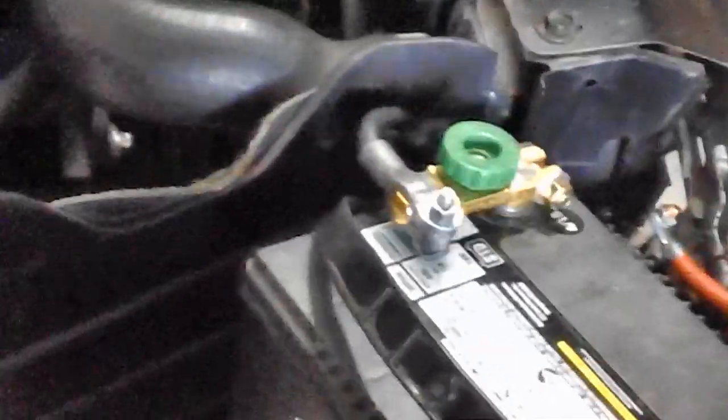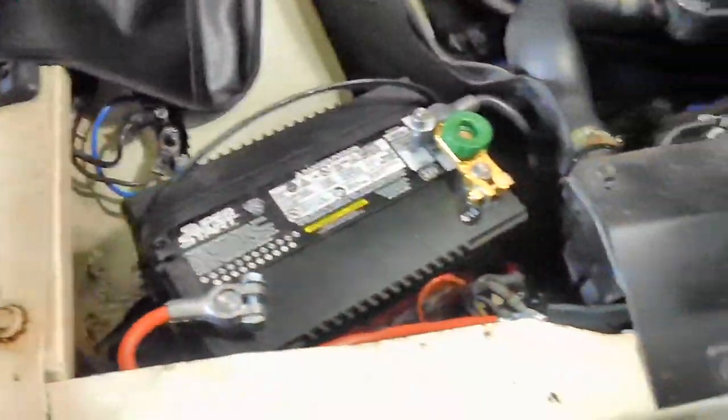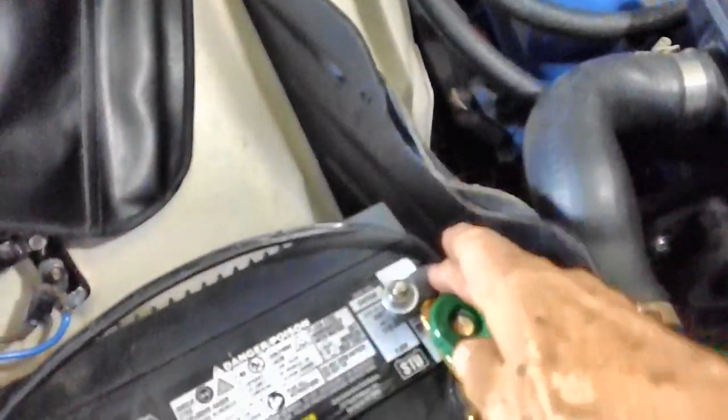So you're back in business on your cable. Now, first of all, why do I need one of these? And how does it work? Well, I do need one of them because there's a lot of wires dangling underneath this car. The wire for this little light indicator alone is underneath there, just hanging. I think one of the headlight wires is hanging. There's no telling what we're going to find under the dash. And I don't want to have to keep coming out here putting the battery cable on, taking it off, putting it on, taking it off. After a while, it'll just ruin the cable and I'll have to go buy a new one. Well, this keeps us from having to do all that.